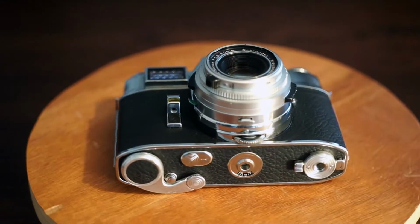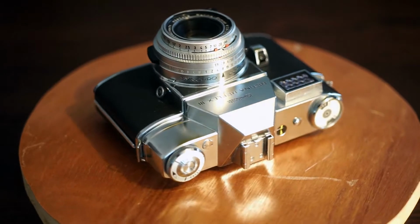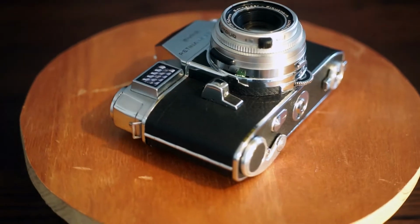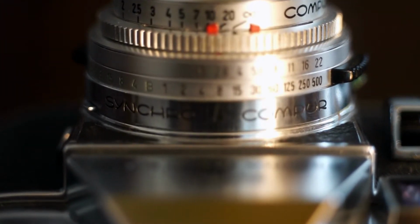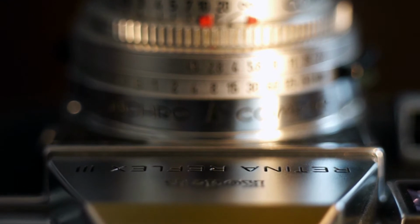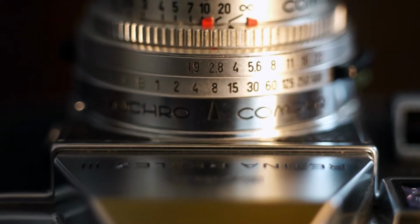The idea of a single lens reflex camera is actually much older, but it wasn't applied to small format photography until the 1950s. Anyway, the Retina Reflex is the result of a somewhat unlikely marriage of a Compur leaf shutter and a reflex mirror pentaprism, offering eye level through the lens viewing and focusing. The downside to the system is a level of complexity that must have aggravated even the Germans who built the camera, and along with it, a lot of added expense and fragility.